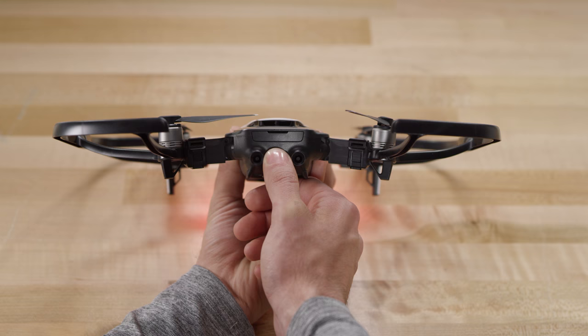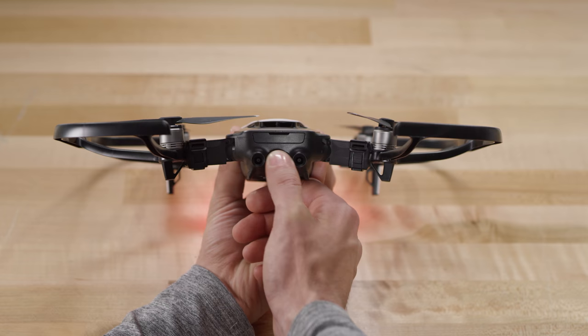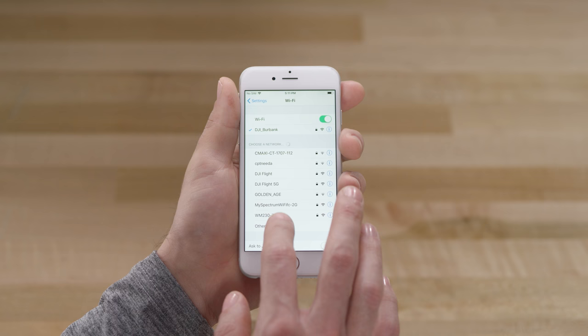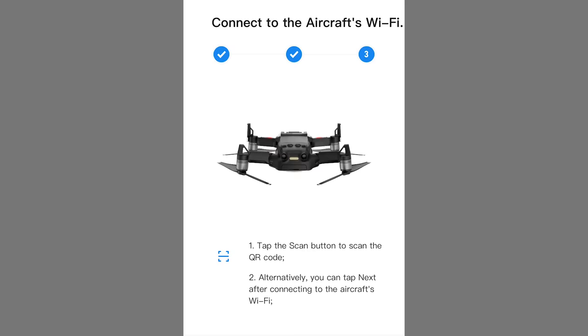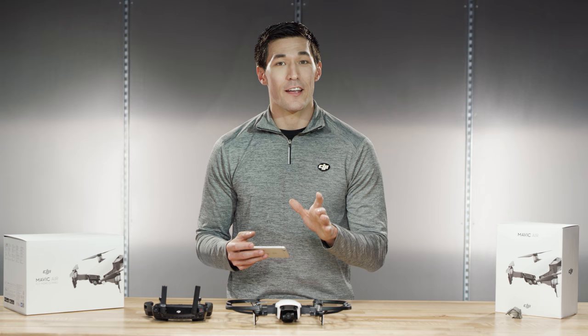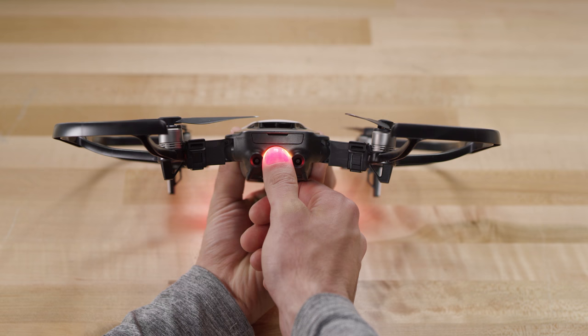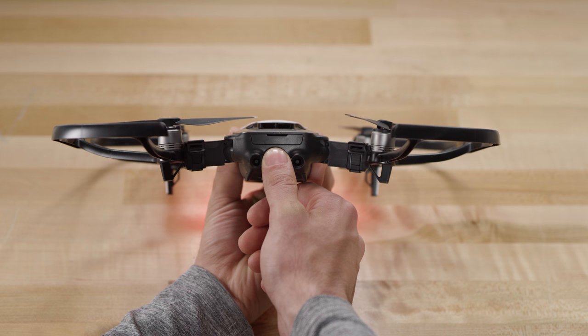To switch to Wi-Fi mode, press and hold the white rear button for four seconds, making sure you hear only two beeps. Join the Wi-Fi network that the aircraft is broadcasting and enter the DJI GO app. You can find the aircraft's password both on the side of your aircraft and on the battery bay. You can go to the general settings to change your SSID and password if you like. If you forget your password, you can reset it by pressing the rear white button on the aircraft — you will hear three beeps.